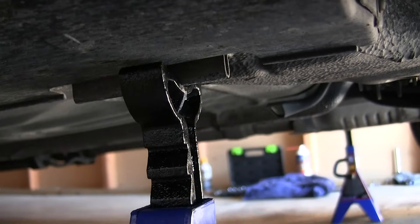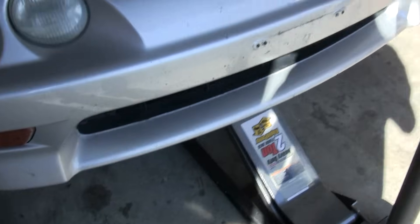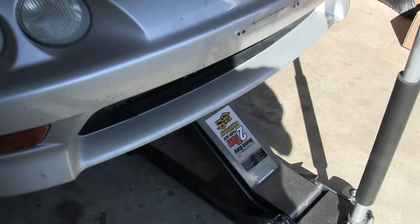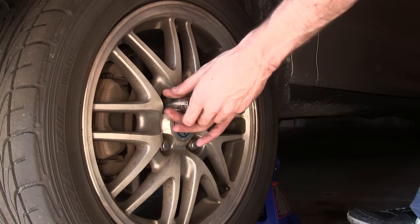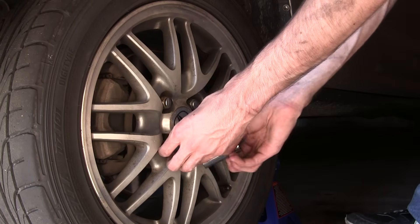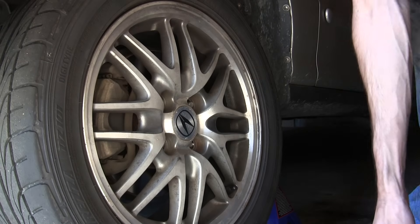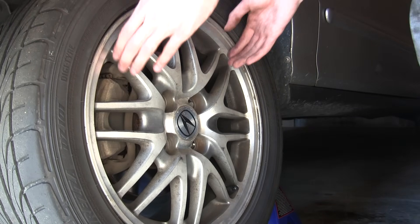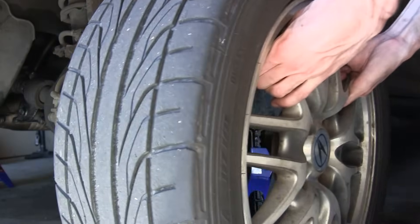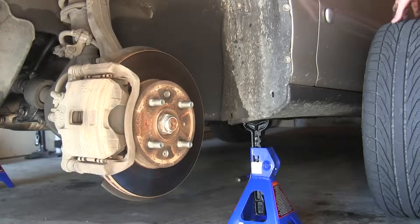Check that on both sides. Unless I'm going under the vehicle, I just go ahead and leave the jack holding up the front of the car as an extra precaution. Now that we've got it up on jack stands we can go ahead and remove the lug nuts. Sometimes your wheel might be rusted on there a little bit so you might have to give it a kick, but then you can simply remove the tire, slide it away, and you're good to go.